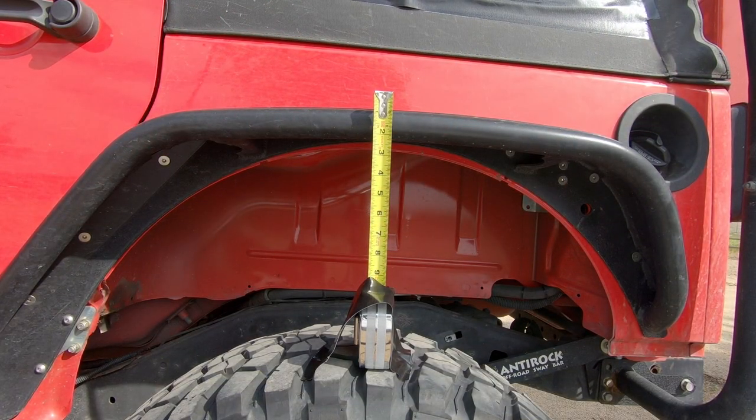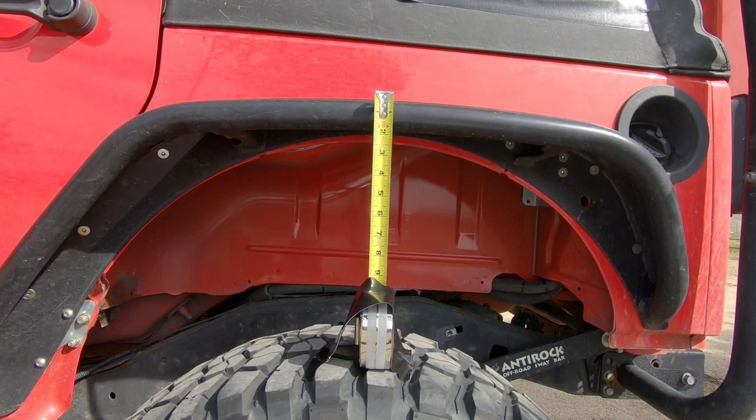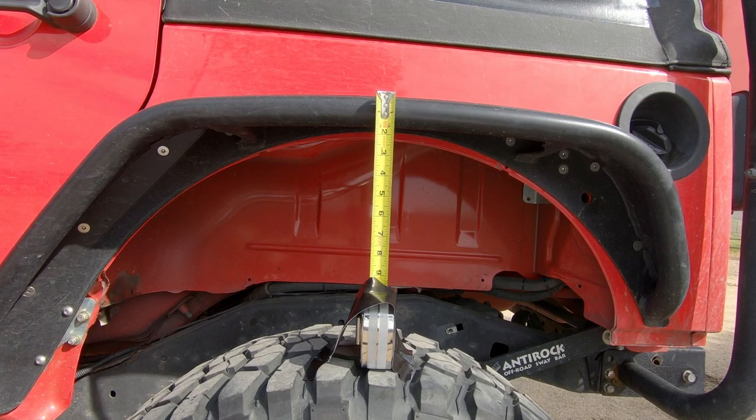So real quick I want to show you just how easy and quick you can fill these bags and get on your way. Keep in mind I am using an ARB twin compressor, so it might be a little bit faster than some systems. Let's check our pressure real quick — that actually has us at 43 psi, which is a little bit much. The max pressure for this system is 35 psi and the lowest pressure you want to run is 5 psi if you're not carrying a load, just so the bags don't get pinched when the coils compress. You can see it gives about an inch of gain in the rear when the Jeep is fully loaded and the suspension is compressed, so it gets me back up to perfect ride height. It also stiffens things up a lot and I don't get a lot of the left-to-right sway that I would normally get if I didn't have the bags installed.